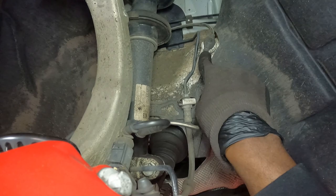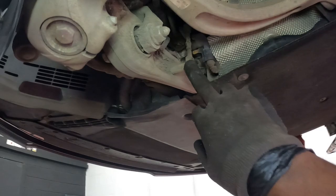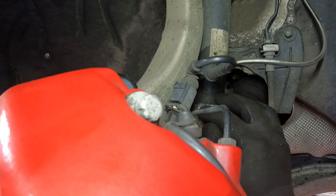First things first, we've got this wiring harness here which is just slotted in — it's literally just a case of pushing it up a little bit and it comes out. This particular car also has a headlight level sensor with a 10mm bolt, so we're going to take those out. Then up here we've got the actual damper with a 16mm bolt and nut — we're going to take those off.